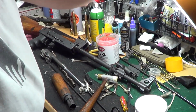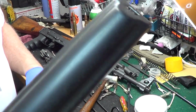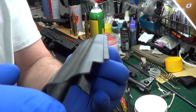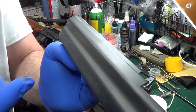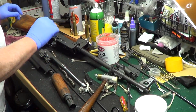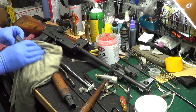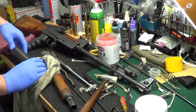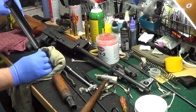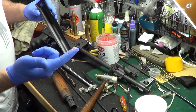I don't know if I can get this little light over here that'll help that or not. Does that help at all? To see kind of... See my finger? Got a little bit of rust on it. I'm going to go ahead and molly coat all this. So first I'll wipe it with this rag. That's probably got a little molly on it because I've been wiping off molly. And then I'm literally going to coat every piece of metal on this sucker that I can get to with some of this red molly.